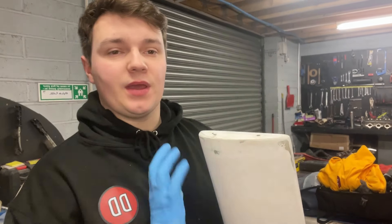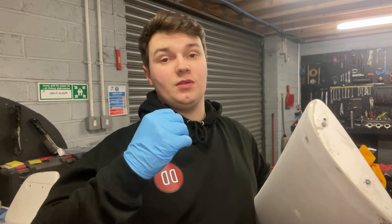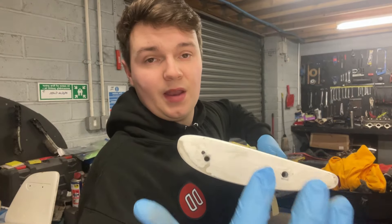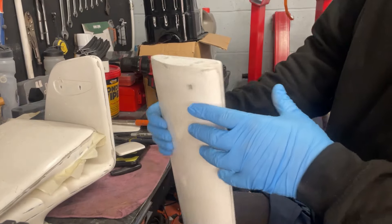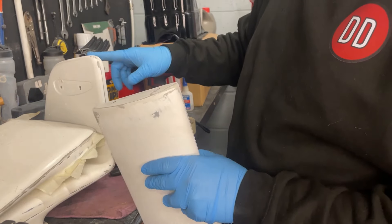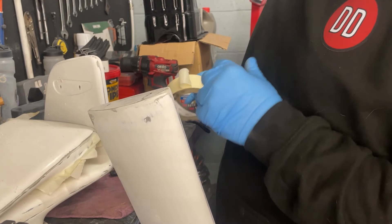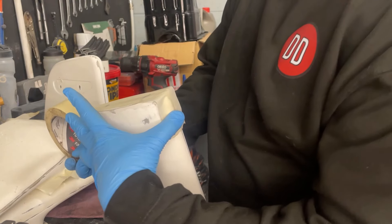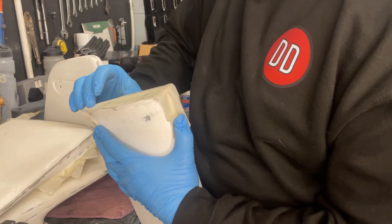The blade on the wing has these threaded inserts, so in terms of modifying the hole to get the bolts in, I need to do it on the supporting arm side of the wing. What I'm going to do is get some masking tape on those two holes, mark them up, then stick the tape on the wing side so I know where I need to drill for this to line up with that perfectly - no trial and error. I'm going to lay the tape down sticky side up so when I transfer it, it's the right way around. If I did it sticky side down, those holes would be in the wrong place - even a few millimeters makes a big difference.